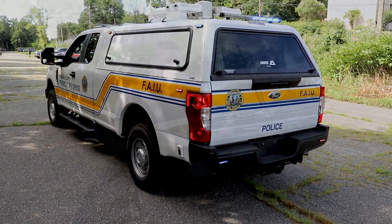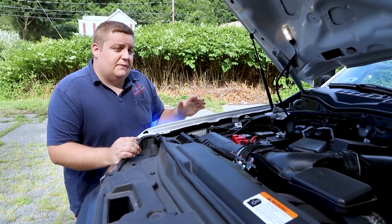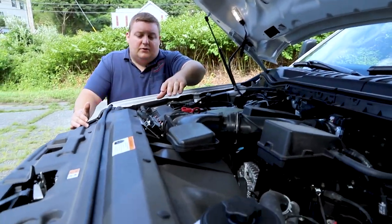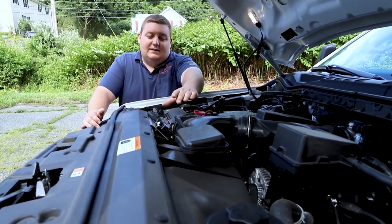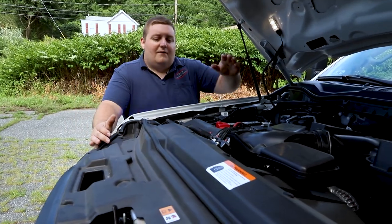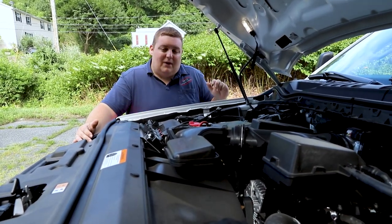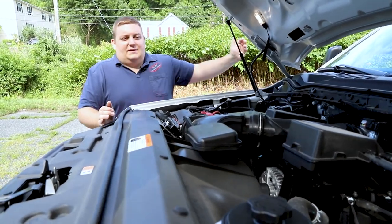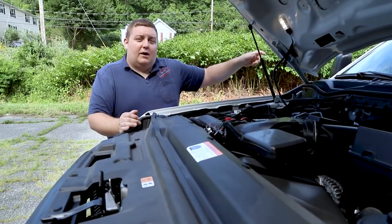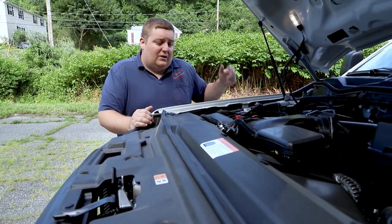You can see the dim mode on the warning lights. Power distribution is always the biggest concern for us, along with serviceability and separation from the vehicle's factory electrical system. We have our breakers along the front here with separate breakers for different components: a lighting system breaker that feeds underneath the rear seat and distributes from there, a dedicated separate feed just for the light tower to ensure maximum power and light output, and an inverter-charger breaker. The inverter system produces 110 volts, and if you plug into the shoreline it will also charge the vehicle's battery for extended storage or to recover from a dead battery.